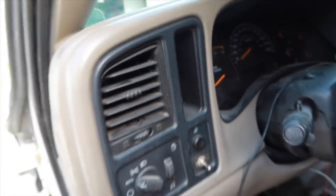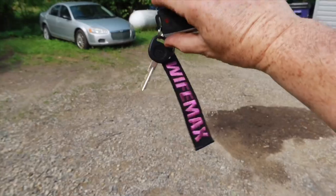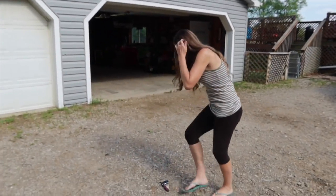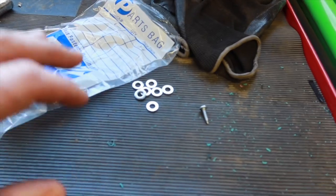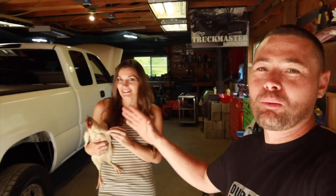She's all hooked up — she's got the Boost Auto Parts retrofit key fob, she's got the key tag. Today I'm going to show you guys how to level your tow mirrors for 96 cents using six millimeter washers. If you want to use three on each bolt, you're going to come out to a total of a dollar 44. We're finally going to level out the Boost Auto Parts tow mirrors.